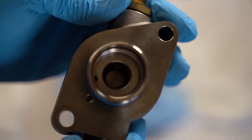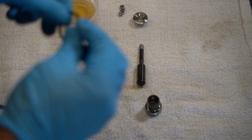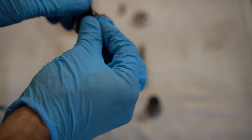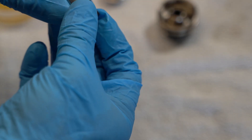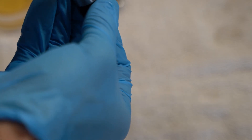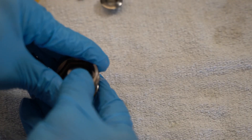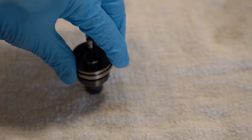This is the cleaned high pressure fuel pump. Now I'm assembling the internals with the new Autotech components and lubricating everything with motor oil — this is a synthetic platinum, just a regular clean oil. Don't use used oil — including this O-ring here, I like to seal O-rings. Inserting the piston shaft into the top part of the pump housing takes a little bit of pressure because you've got to get through those seals — I found pressing it against the bench helped. A really thin coat of oil on everything is just going to lubricate it until it can get pressurized with fuel; you don't want it to be dry at startup.